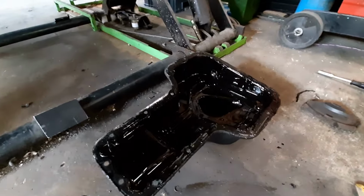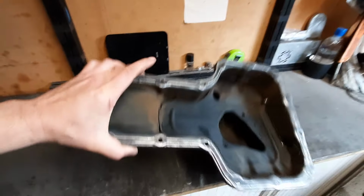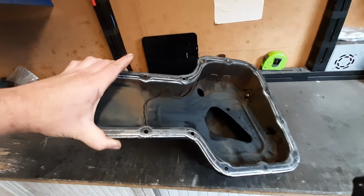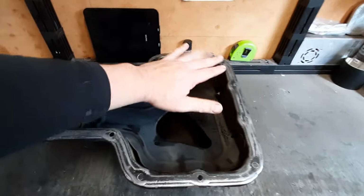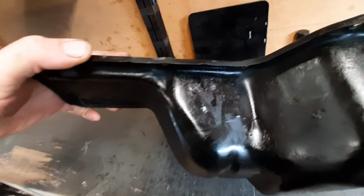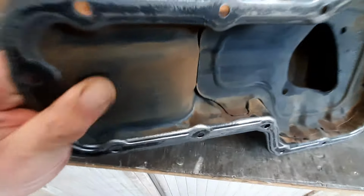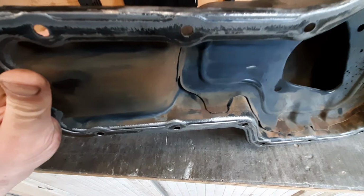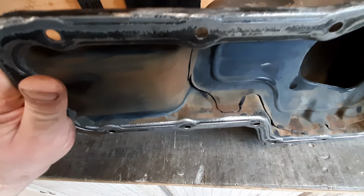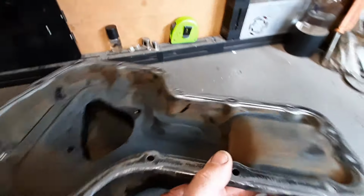So that gets our sump off. We'll give it a bit of a clean out and then we can have a drill. We've got the sump off now, giving it a bit of a clean out so it's not an oily, disgusting thing. Cleaned all of the gasket face up in preparation for refitting. Now what we need to do is drill our hole here. X marks the spot, but there's a bit of webbing in here for the splash pan. So avoiding that and getting us a good fit on there is the aim of the game.